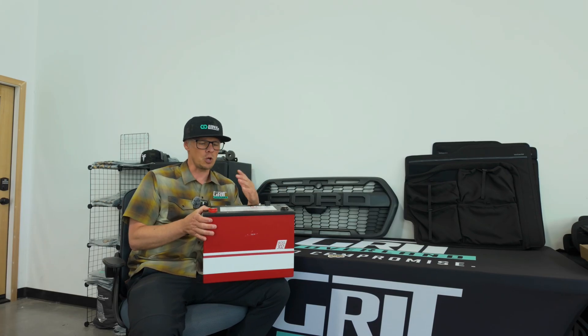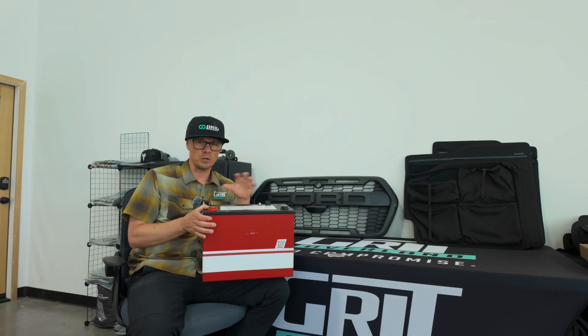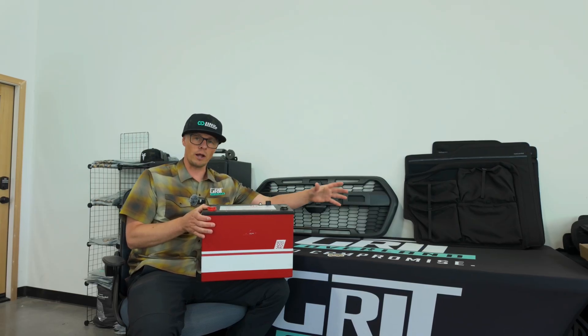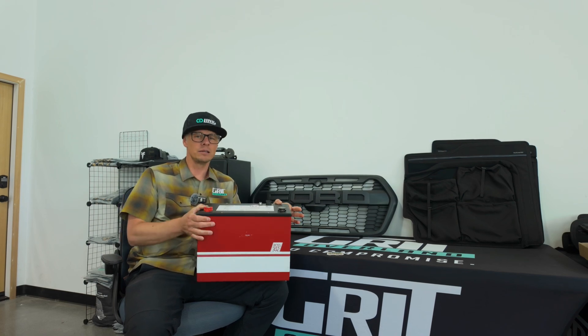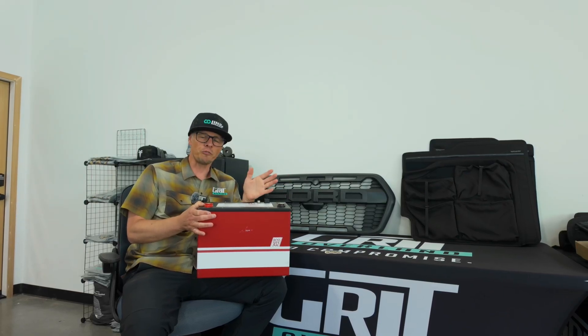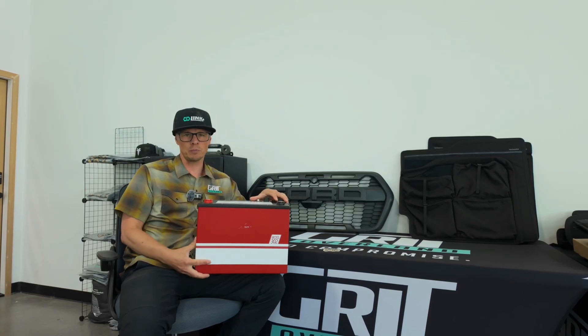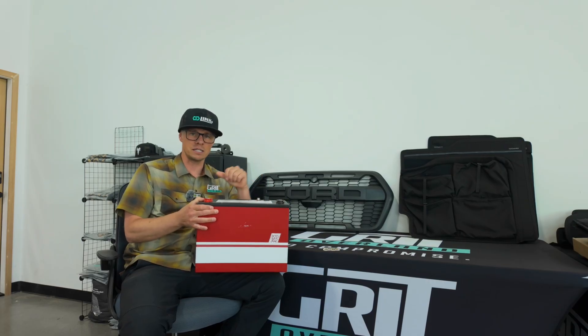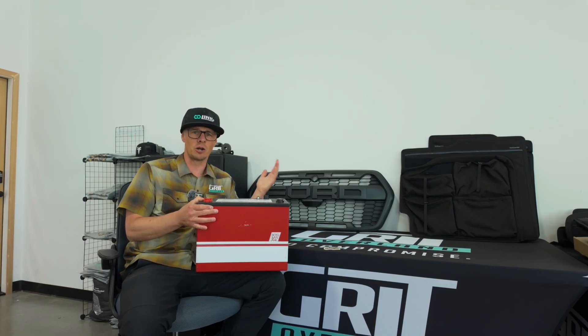What does that mean for the end user? We run this at 12 volts — and nobody else in the industry is really doing this. 150 to 200 amps running back to this battery pack, and then a 12-volt air conditioner on the rooftop, that Dometic RTX that we install. On one charge of this tiny battery pack, you can run that Dometic air conditioner for 15 to 16 hours on eco mode, or five to six hours on maxed-out high. For somebody who needs extra power, we can easily add a second pack — still UL listed — for a total of about 8,000 watt hours, giving you 30 hours of AC runtime down to about 10 to 12 hours on high.